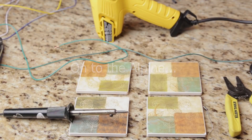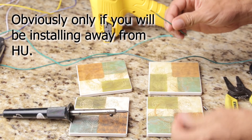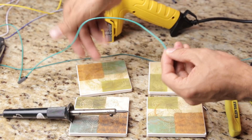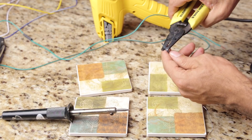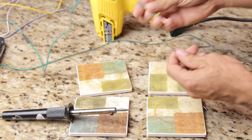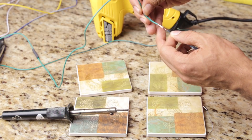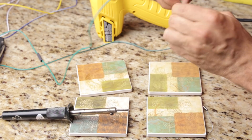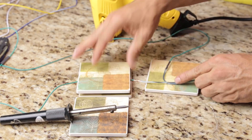The Alpine power pack is meant to be installed close to the head unit, so the wires are not going to be long enough to reach under the passenger seat and they have to be extended. Now you can use butt connectors to simplify this part of the install, but I always prefer to solder. Put the heat shrink through the cable before twisting the wires together, and then move it away from the joint. Then strip about half an inch off the end of each cable. Overlap the strands of the cable and then twist them together. This is just a basic inline splice — they're pretty easy to make, solid and forgiving, and they also look pretty clean when they're done. All of the tools you see here are pretty cheap and they're worth having around if you like doing things yourself.